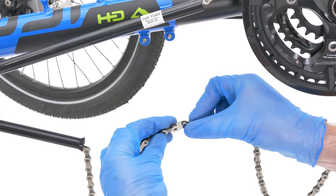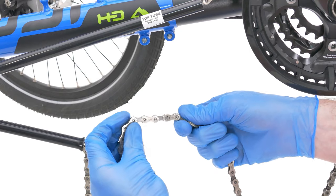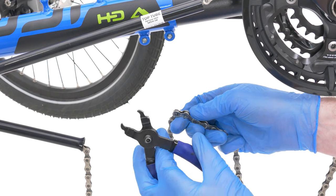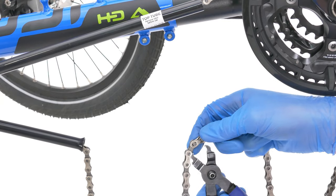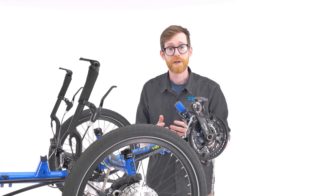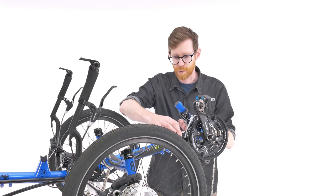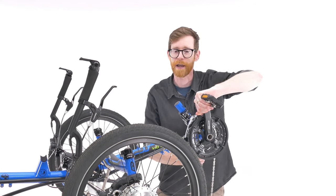The quick links come in two halves, which are absolutely identical. Push one half through the end of the return chain and the other half in the opposite orientation, then place them together and they lock by pulling. Some of them can be a right pain to click together — you can use quick link pliers to help. If you can't get it to click, leave it for now. Once the back end is set up, run the chain through until the quick link is on the drive chain, then use the cranks themselves as a lever to click those quick links into place.